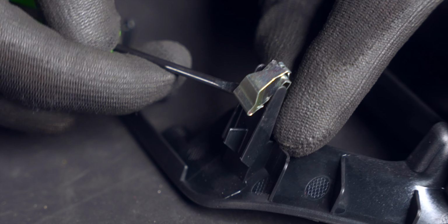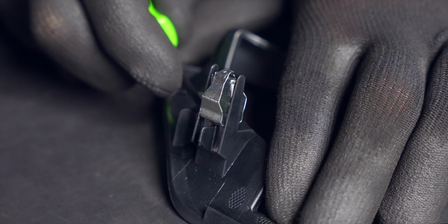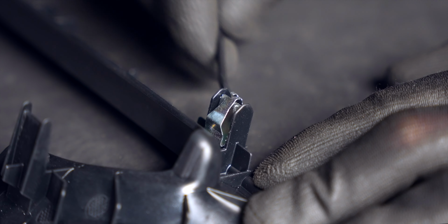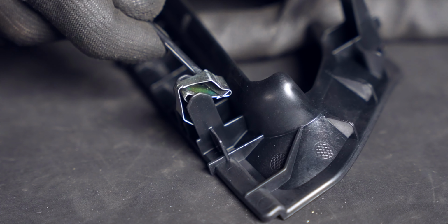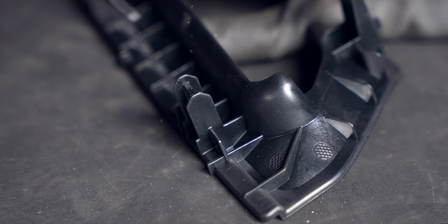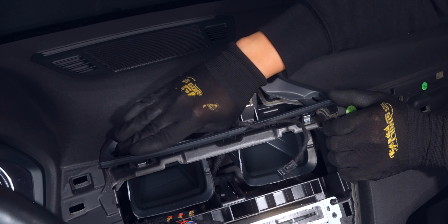If you plan on reselling or putting back in the old screen in the future, just take your time here, as you don't want the plastic tabs to break. Once you've unseated the teeth, it will walk off with a few alternating lifts, and in some cases, you get lucky. Once they're all in, it should drop in just like OEM, with all the alignment and locking tabs lining up perfectly.